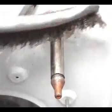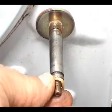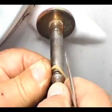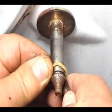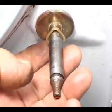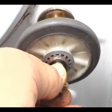Use a wire brush and clean the shaft real good, then wipe it off. Next, install the first triangular piece using a small screwdriver to help. This one is a little bit harder because you have to push it to the next groove. This piece will stop the roller from sliding too far in. Set the roller in place and install the other triangular piece.